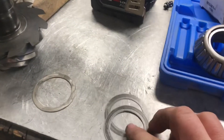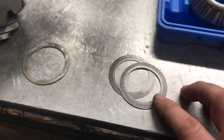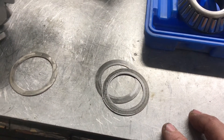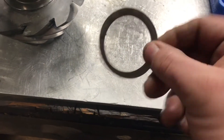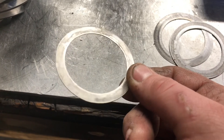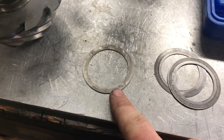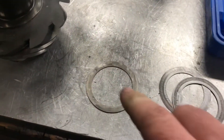I did a little research, a little googling, and I measured the shims I have. I've got thirty-three thousandths of an inch. From my reading it seems like Ford typically puts a 28 to 30 thou shim underneath the bearing. I dug through my stash of shims and I have one that measures 28 thou. It looks used, like I might have ran a stone over it at some point. That makes me think that when I had the original 3.55 ratio gear set in this car, maybe it had this shim and I had to go to the thicker ones to get the contact pattern correct. So taking a chance, I'm putting that 28 in.